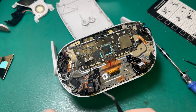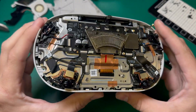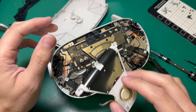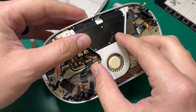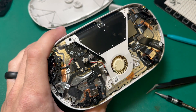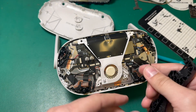Now that the motherboard is secured, I can start putting all the cables back where they need to go. We'll put the heat sink back on at this point. I've got enough things plugged in to test and make sure the LCD is functioning properly. Now we can put the fan back in place — similar to the inverse of how we took it off, this has to slide up and hook underneath the frame. There are a couple of little holes that have to line up for the LED sensor. Once those are lined up, it should sit flush. Next, we plug the fan back in, and then put the Bluetooth antenna and spacer bar back in.